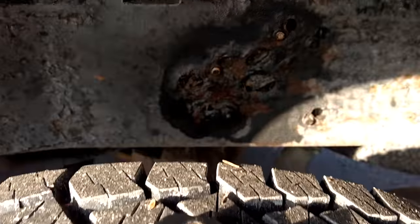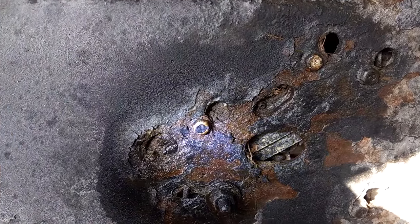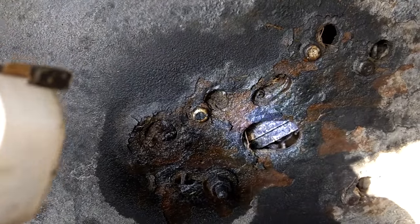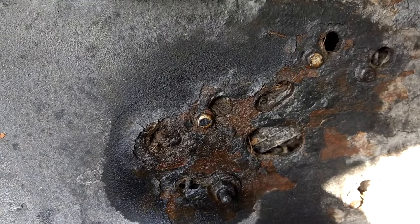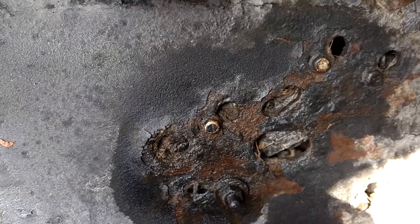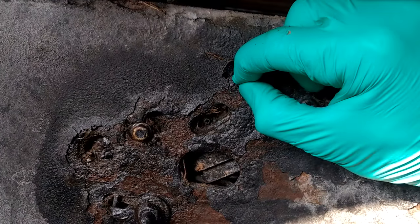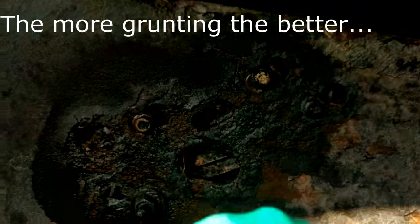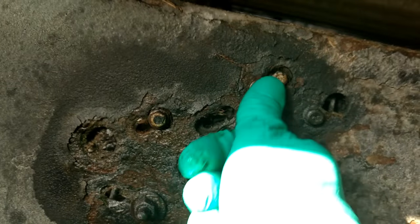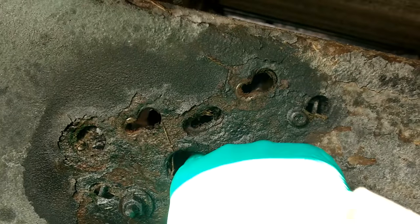To replace this relay you can actually loosen the bolts from the outside. You can see how the holes get a little bigger to the right — you can actually slide that whole relay and just drop it out the back side, so you don't have to take the bolts all the way out. You can just drop it out and clean all the mud out of it. There it goes — drop it out the back, and it is plastered with mud and salt.